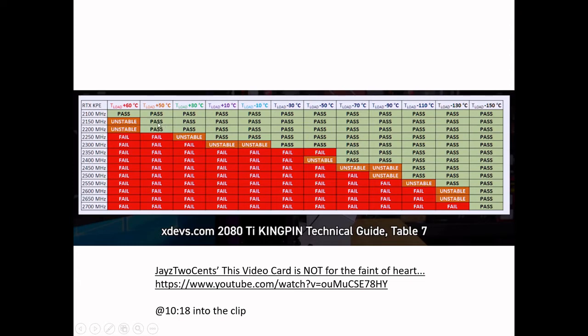From this table, if I get in the range of 2.1 gigahertz or anywhere in the 2.1-plus gigahertz range, I have reached the limits of the card. One of the things I've learned about the RTX 2080 Ti is they've shut down the power, so you can't really increase the power to the GPU. Even though you're running really cool with a lot of temperature headroom, there's no way you can really push it further without flashing it with a custom BIOS — and I'm just not going to go there.